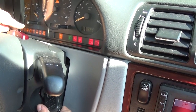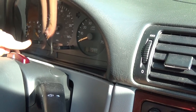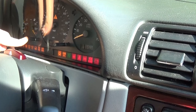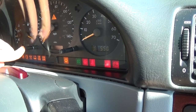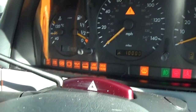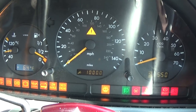After that, turn the key off — the indicator is still there — and hold the button. Keep holding it, then turn the key to the second position again while still holding, until you hear the beep. The new mileage is displayed: 10,000 miles. That's the whole procedure, guys. Pretty simple but you need to do it quick.